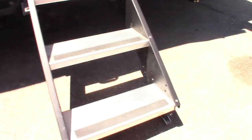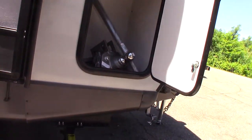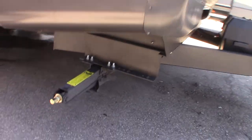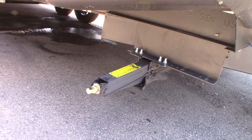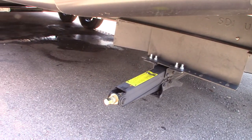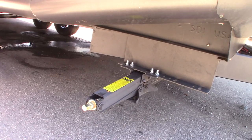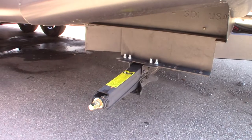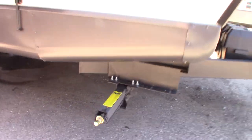You can adjust these steps — each leg is adjustable so you can adapt to the terrain. On each corner there's a scissor jack stabilizer that takes a three-quarter-inch six-point socket, and you can also use a three-quarter-inch six-point socket on a drill if you want. Just don't over-extend or over-retract them — you don't want to break them. You don't lift the trailer with them; you just take the wiggle out of it.